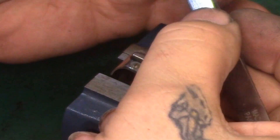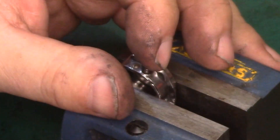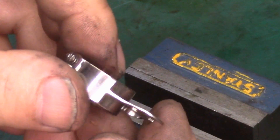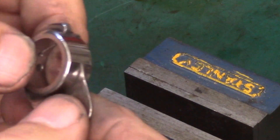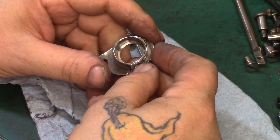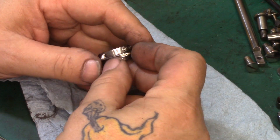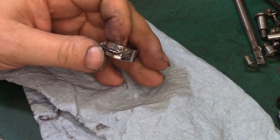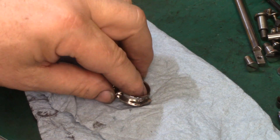Its shape is what actually makes the adjustment screw a little more difficult than the tiny one, but getting it in place with a pair of tweezers and then getting in there with a screwdriver and tightening it up — there you go, it's in. We'll adjust tension on that when it comes time to put it back into the machine. There you have it: a clean and polished Singer 66 class bobbin case. Thank you so much for watching — we'll see you on the next video.